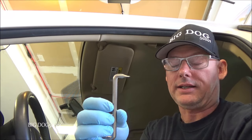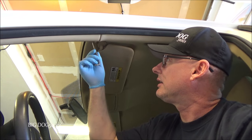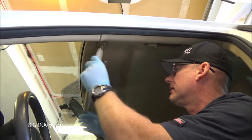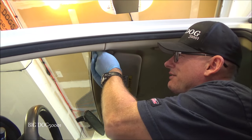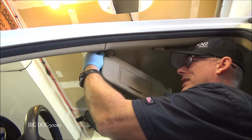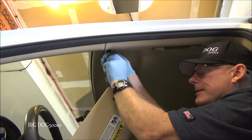To get at it we're going to need some kind of flat tip screwdriver. I like to use an angled one like this Craftsman. I press it in there — there's a little tab in there I'll show you once we get it out. Once it's pressed in, we maneuver it to about this position, then the whole thing will come down. Press the tab in, you'll usually hear it pop, then put it at a 45-degree angle and it pops down and you can just pull it down and unclip it.